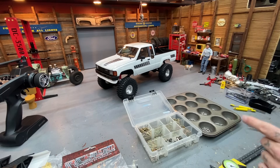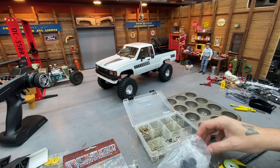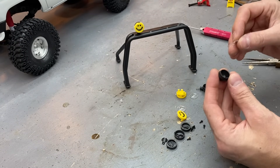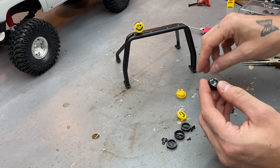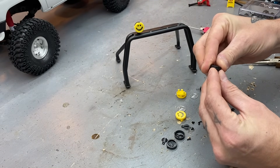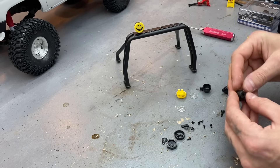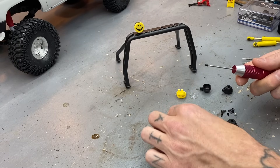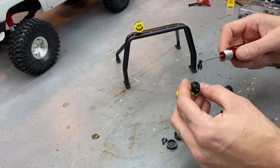I'm going to move some of this stuff out of the way, start on the roll bar, and look at these KC Highlights. They're multi-piece with lots of little things going on. The lens kind of snaps in — it has KC on it, so I oriented it correctly even though I'm not going to be able to see it. The outer trim ring goes on, the little flaps go at the bottom, and that holds it together. Then you snap your cover on and find the smallest screws in existence. We put in the LED retaining part to close the back of the housing up.